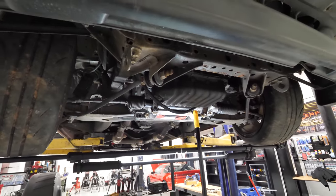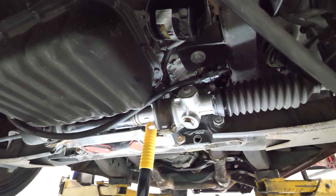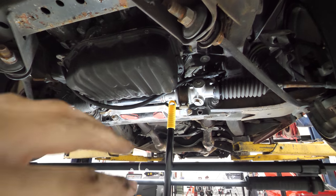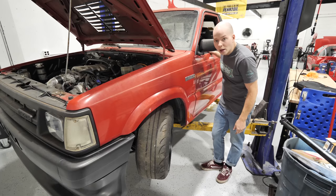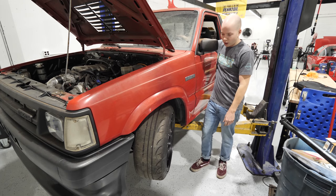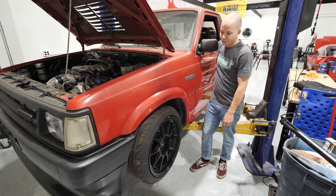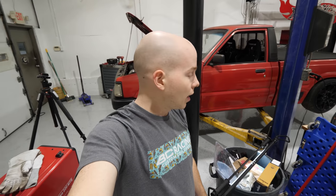A couple of awesome things about this new mount: the steering rack is mounted higher, so the tie rod angles will be better. It'll also be better for the U-joint angles on the steering shaft — it was pretty sharp before — and it still clears everything perfectly. So we're going to tack that in, then fully weld it, brace it, paint it, and get this thing running again. This will be the first time it's steered in a long time. It's a little stiff, but it's steering. I went lock to lock and it seems okay. There was a chance the steering rack itself had been bent or damaged, but I think it's fine.